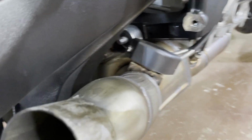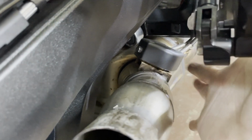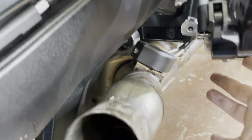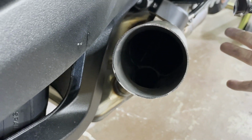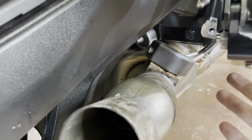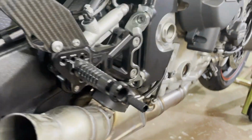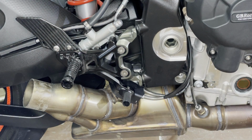You see this little box, we're gonna get that screw and remove it so that we have access and can remove this, and then get the little flapper. There's a flapper in there that can open and close, and that is for back pressure and also noise regulation. So that entire thing comes out, and we're gonna follow the cables, and then this little box here, which is right there, just like you remove the screw, and then this one, the fat finger's in the way, this comes all out. So let's do that. Good, this was an 8mm, so that came out.